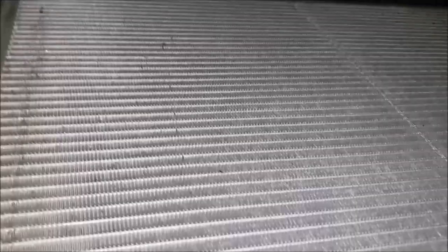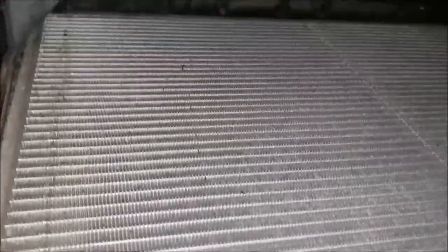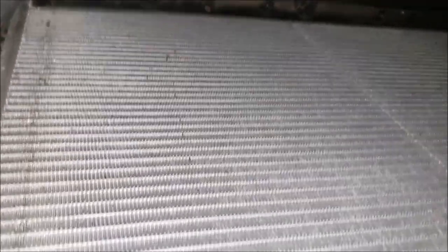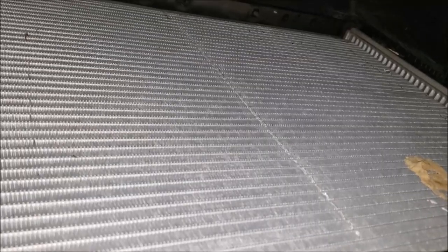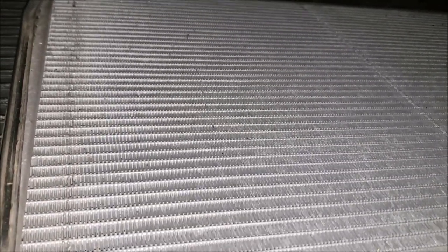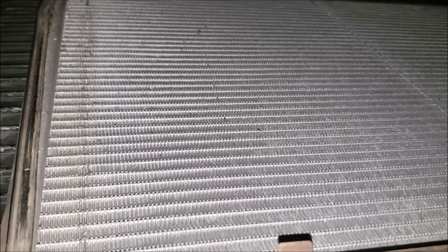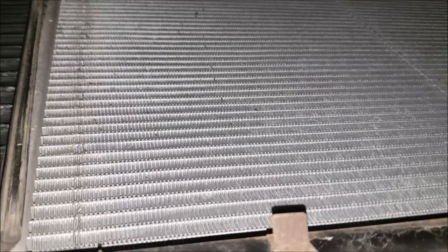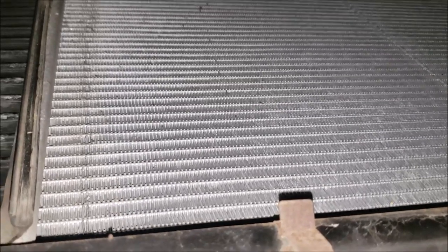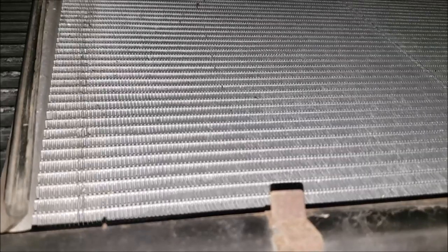I've got a plan and I'll see if it works. Since we've got the fan stuff out of the way, I've set up a little spray nozzle on a water hose. I'll spray some Simple Green in here to loosen and soak the dirt — you want to be gentle; don't use something too strong that'll damage the fins. It's about four in the morning, so I'll start the project tomorrow. This is a 2005 Itasca on a W24 chassis with an 8.1 Vortec having overheating issues.